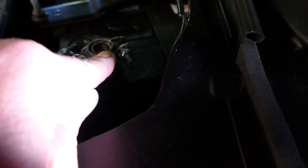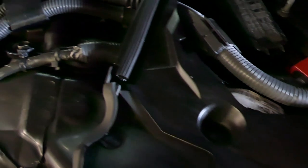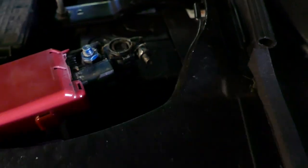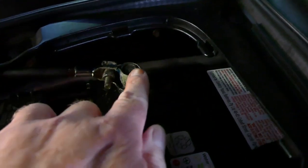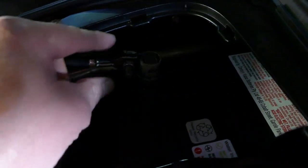So here's my little hack that I recently did. I've put the battery back in the 350Z out of the Land Cruiser, and I modified it — it took me an hour to put all the clips and mount the battery back, which is a real pain. These have those stupid tiny thin little battery connectors and they're really loose, which you should never have. I had some old lead strips from my uncle's place, and inside those terminals I've put a thin lead strip, which I cut and wrapped around the post. I squished those right in there, which is a hell of a lot better.